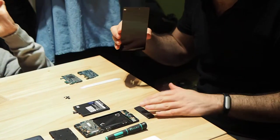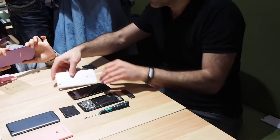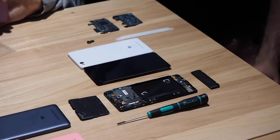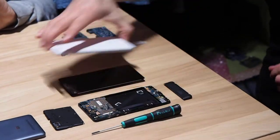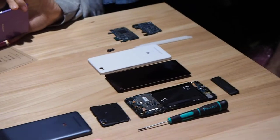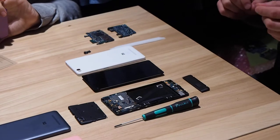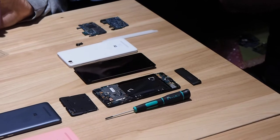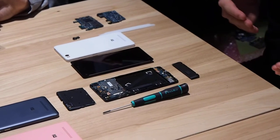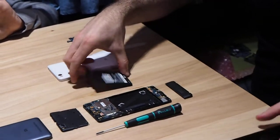And the amazing thing is that when you put the display on top of the battery, basically this defines the height of your mobile phone. Right? You can see that. All I did was I put the display on top of the battery, and that's the height of the phone. So that tells you how important it is to focus as much attention as possible on making the battery as thin as possible. But how can you do that when you're trying to put in a battery that's well over 3,000 milliamp hours? So that's the whole challenge, which I talked about earlier, of building such a thin battery.